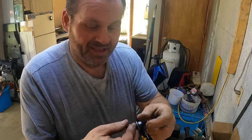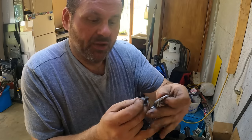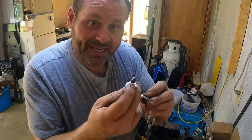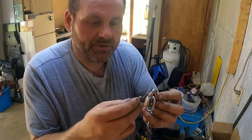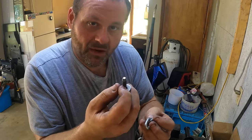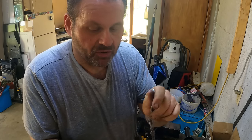I've got a 5/16ths bolt right here. The reason I went with a 5/16ths bolt is you can kind of get a 3/8ths through there, but you've got to spread the chain out to get it in. If I ever want to take this chain up a link at the track, I want to be able to just stick that bolt in there easily. I went with the 5/16ths because this is only shear force — no problem at all using the 5/16ths. Like I said, not a ton of pressure on these.